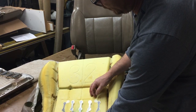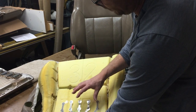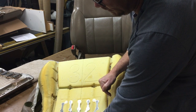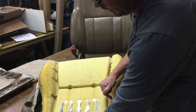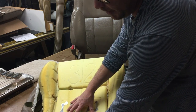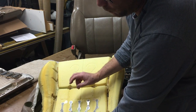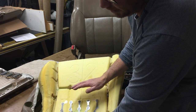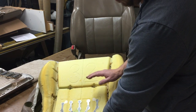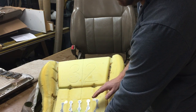This is off my passenger side. I did not put it back, and I did actually test the passenger side without the occupancy sensor and without the seatbelt detect hooked up, and it was just fine. This has nothing to do with the airbag. It won't disable the airbag. The occupancy sensor / seatbelt warning light on the dash is not connected to the airbag system in any way. I verified that on the wiring diagram, so you don't really have to put it back in there.